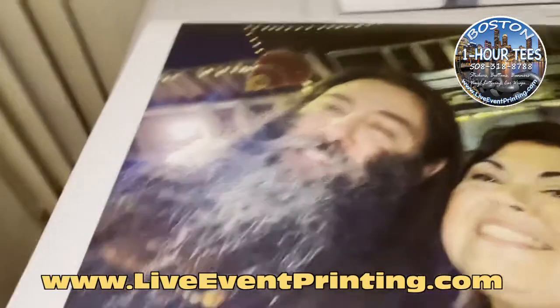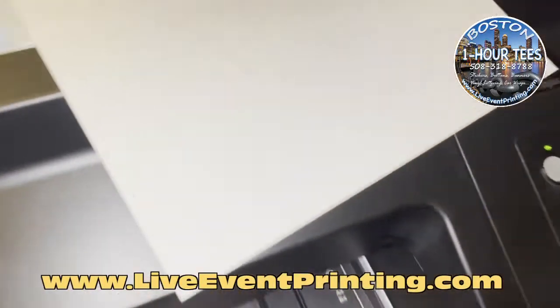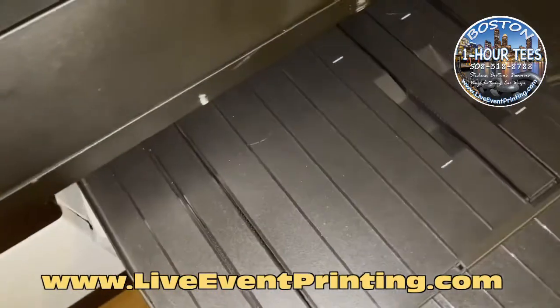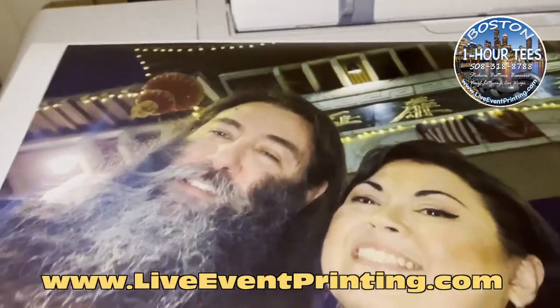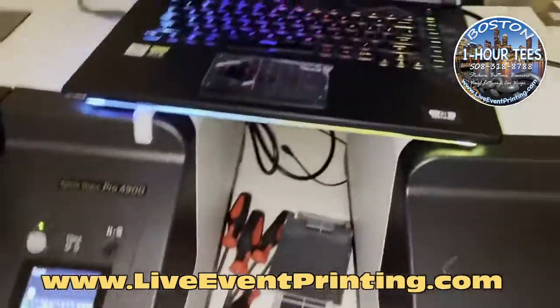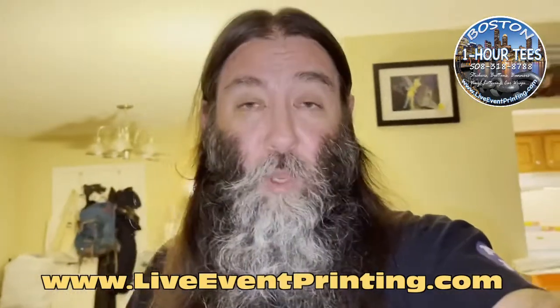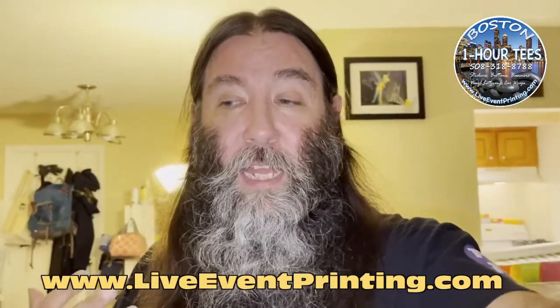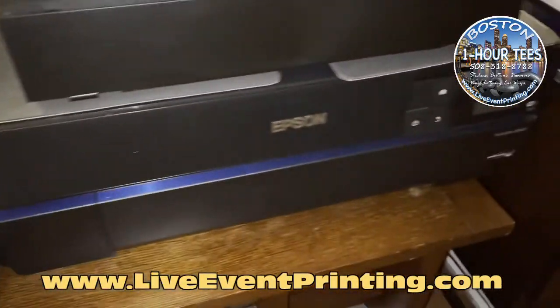Alright everybody, that's the Epson P4900. We have more of these 4900s here than just about anybody out there — perfect nozzle checks. Let's go ahead and close this down so nobody in my family crashes into this. The most amazing print. The speed of this is amazing. So if you were to DTF print on these printers, you're talking CMYK plus five to six whites — or CMYK plus three white. And then you can do your fluorescents as well. These are photo production printers, and the capability of these printers is far beyond the P800 or the P600.